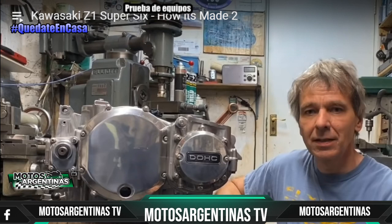A quick try on the engine and it fits lovely, and the curve is absolutely perfect. So now at the right at the back, a wire comes out from the oil pressure switch, so I need to file half a hole to match the half hole in the engine. So I just mark that with a pen, take it across to my vise and file it out with a round file.